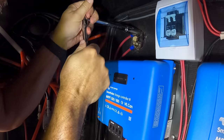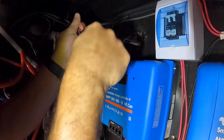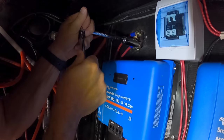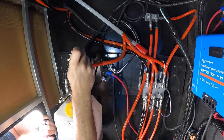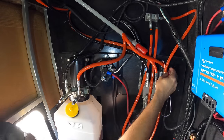But one thing up in there that I had never messed with turned out to be very loose — that DC shutoff connection on the wall between the front bay and the basement. Those were quite loose. I've never touched these before. I also checked all of the connections going to the hydraulic system and checked for any hydraulic fluid. So I am pretty good up here now, and I did find some loose connections.